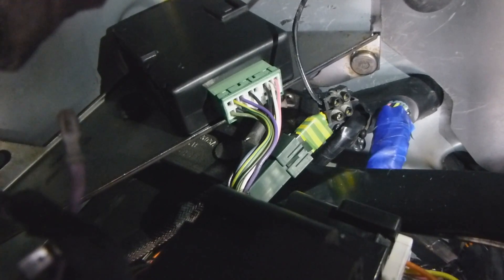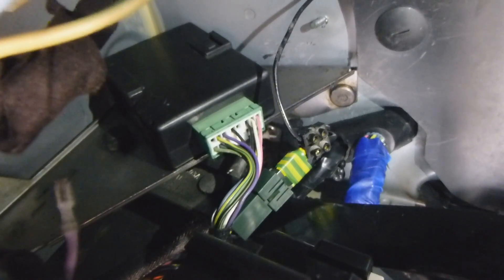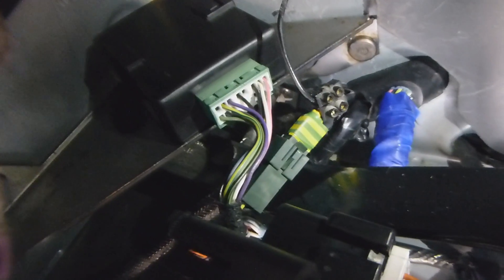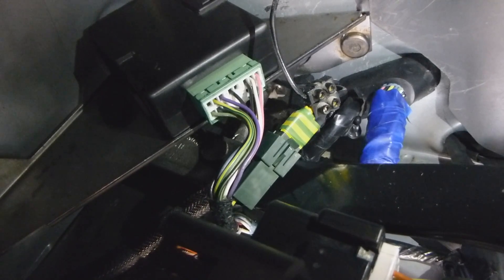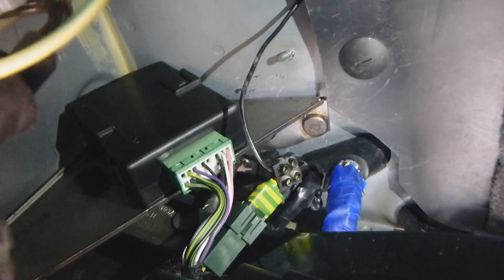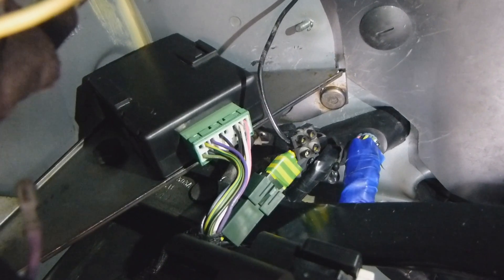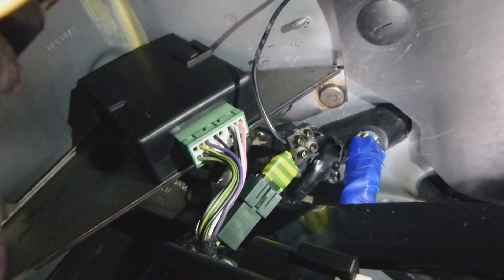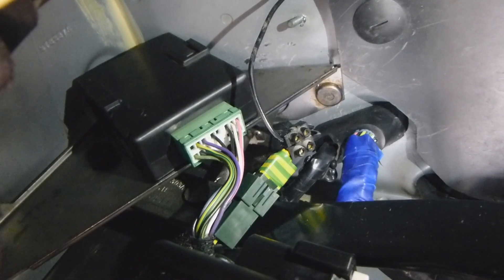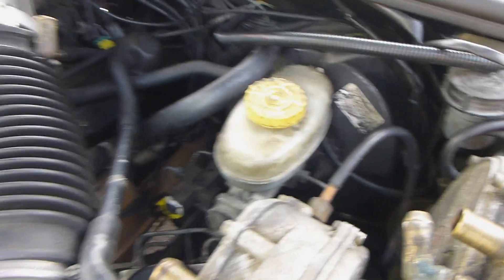This workaround may or may not work for you, especially in the US where I'm not sure you even have a clutch interlock switch. For Europe it's a surefire way to avoid having to swap in a Dodge Ram 5.2 five-speed ECU. But if you want to try it, check underneath your dash for that green connector — if you find it, wire it up as I did. You don't have to go through a master cylinder switch; just use a push switch when starting and see if it works. If it does, you just saved yourself an ECU.